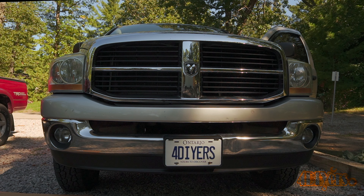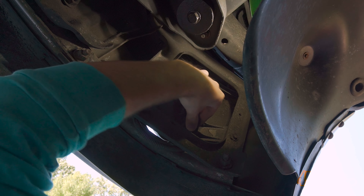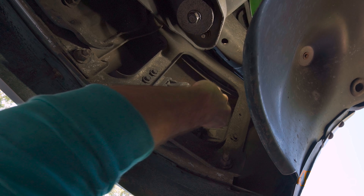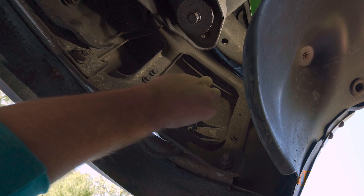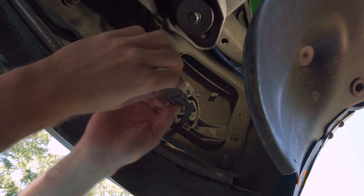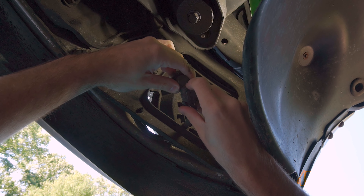Installation is fairly straightforward and it's just like replacing your factory halogen bulbs. As a brief overview, you'll need to access the rear of the lights — for this Dodge Ram it's done by going under the truck. Other vehicles may require the light to be removed or you'll need to remove a cover to gain access. Twist the bulb counterclockwise until it stops, then pull straight out. To disconnect the old bulb, there will be a tang that needs to be slightly pulled out, then pull off the connector.